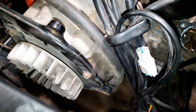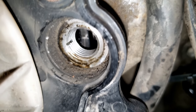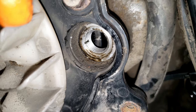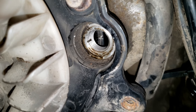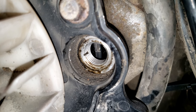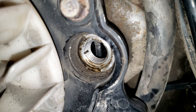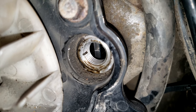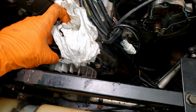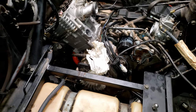Inside there you'll find a plastic screw cap — remove that and inside you should see some marks. If you need top dead center, keep in mind this engine rotates counterclockwise when you're looking at it from the passenger side. The first mark you see is basically a firing timing mark — rotate a little bit past that and right there is top dead center. I slightly wedged a paper towel in between the cover and the fan so they'll stay in place.